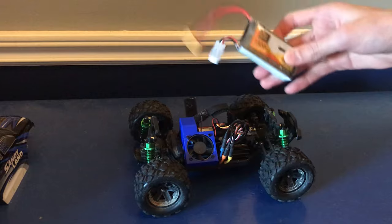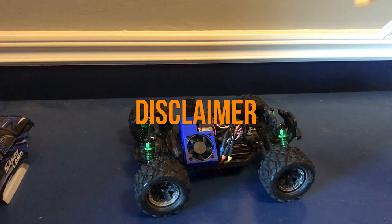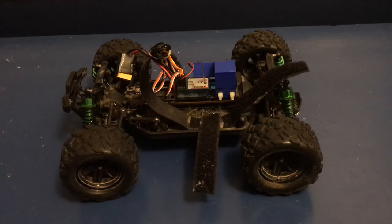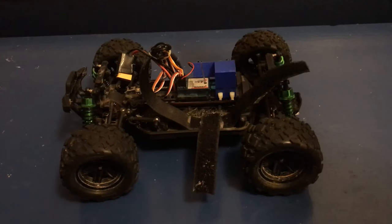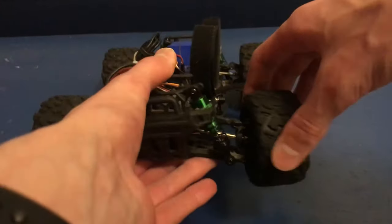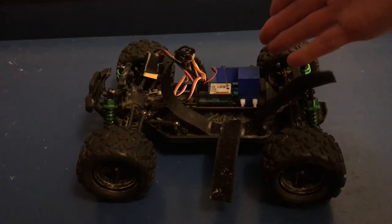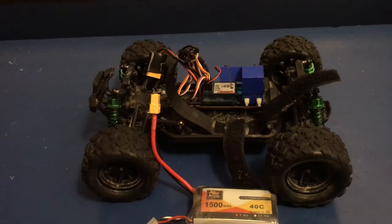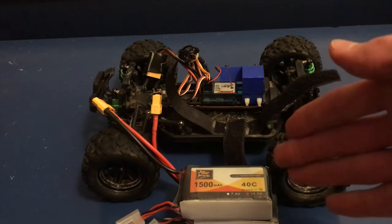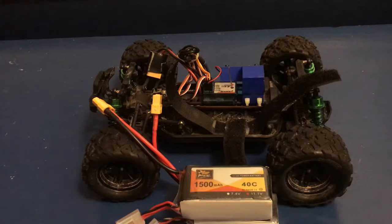So for the first run, I'm going to be running it on 2S. I know the whole point of the fan was that we could run it on a 3S LiPo, but for just the first few runs I want to run it on 2S just to check it out and make sure I installed everything right. Actually, quick disclaimer — it turns out we're not going to be able to run this thing on 3S today. I've discovered an issue with the Sandyland: it turns out that it does not actually have any bearings — it just has bushings, and those bushings are starting to get very worn down. That causes excess drag on the car, but the real issue is that it creates tons of wheel wobble. Look how much that can wiggle — that is really not good. The wheel wobble causes an inconsistent load for the motor and uneven wear and tear on the rest of the driveline components. The bushings have been wearing down slowly over time, and last time I ran this it ran fine on 2S, so I think we'll be safe to run it like that. But 3S might be pushing our luck, and I'm worried that a bushing or some other driveline component will break. So for now I'm going to play it safe and keep it on 2S, and then later on I'll upgrade the bearings and give it a go on 3S. Anyway, let's get back to the video.